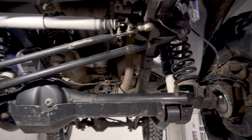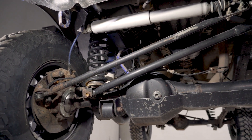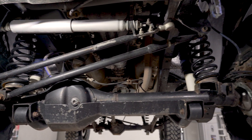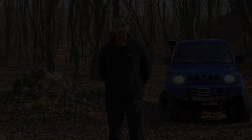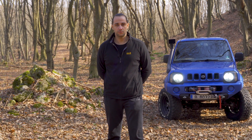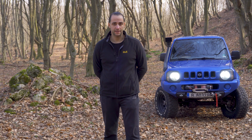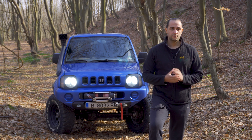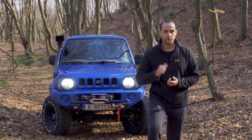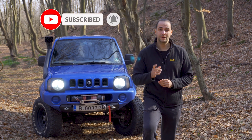Can you go without all those extra items on the list? Sure, but hopefully now you'll know what each part is for and what you'll be sacrificing if you go without it. In conclusion, the higher the suspension lift, the worse it will perform on the road, and the faster all mechanical components will wear down, requiring more frequent maintenance or replacement. That doesn't mean you shouldn't lift your four-wheel drive — it is something you need to keep in mind and stay on top of. Let me know in the comments if you found this video helpful, and consider subscribing to the channel for more off-road related videos.